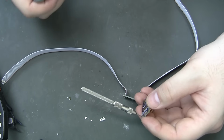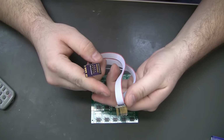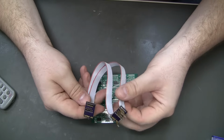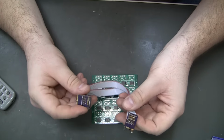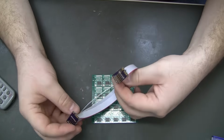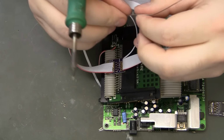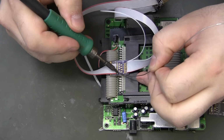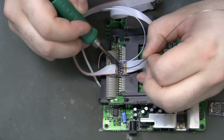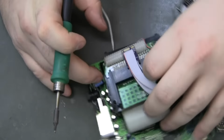Let me get through this off camera. Okay, now I think I'm getting there. Got the pin soldered on for power and switch. And I got the ribbon cables soldered back to the motherboard PCB. So I'm gonna solder that down to something and then maybe we can start trying these. Well, I got really lucky getting the old one off there and getting the new one over the old pins. And then I have to run power over.